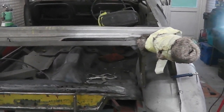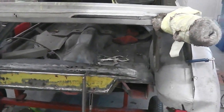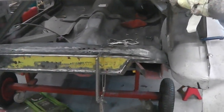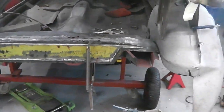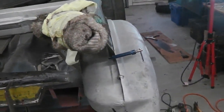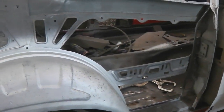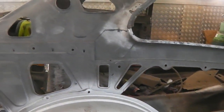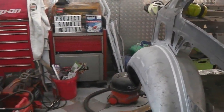Now, because we're a dipped shell, there's been hardly any burn back of paint. That's the advantage that I was telling you about. In the past, I've seen it where you're welding and all sorts of paint starts to burn away and your garage is covered in these awful fumes. That's not what we've got here. We've been all right, quite clean metal, and pretty much along the journey of this car has been clean. But there has been times when I've been sanding paint-covered panels back and there's dust. I'm going to be extra vigilant with the mask.